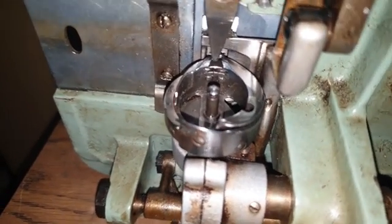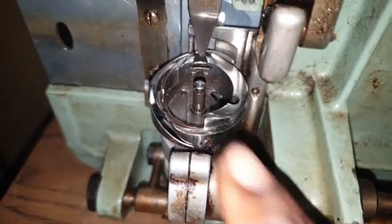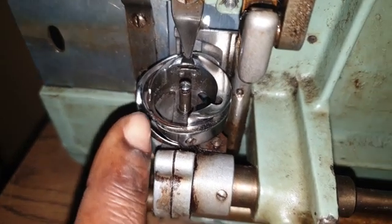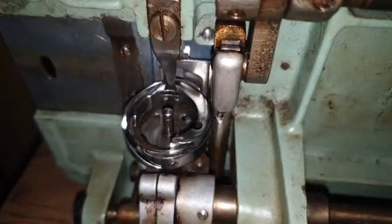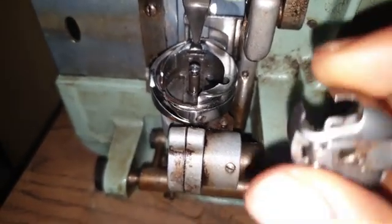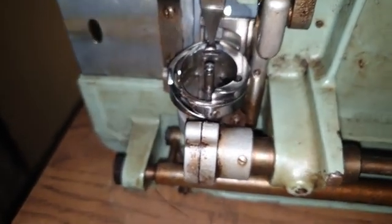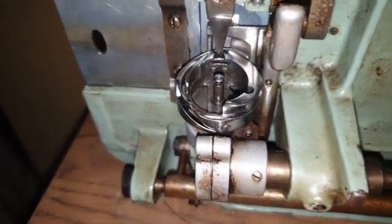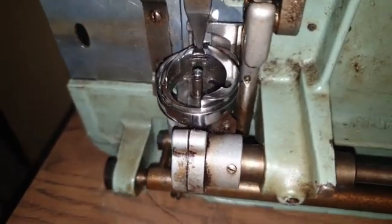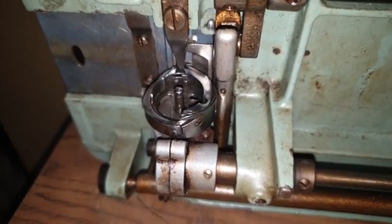What carries the thread in this case is this part here. If you look at your machine, there's this sharp protrusion — this is what actually carries the thread round. The thread coming in from the needle side goes round the shuttle, takes the shuttle thread and actually takes it off. It's a continuous process — that's how the machine works. There's a sharp point here that carries the thread around the shuttle thread.